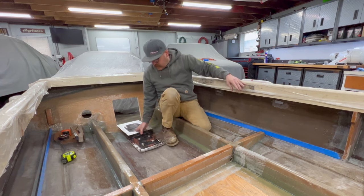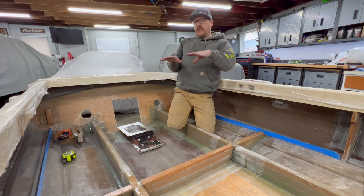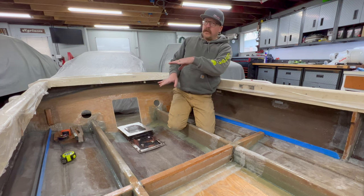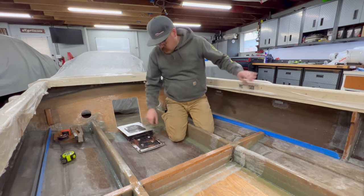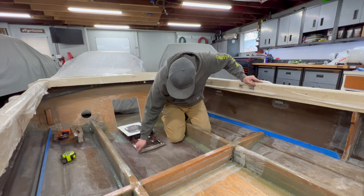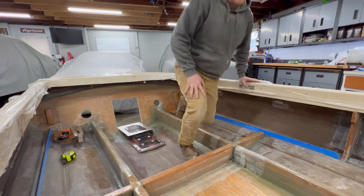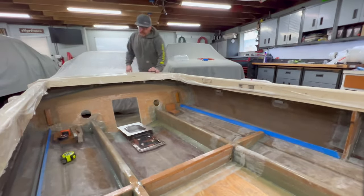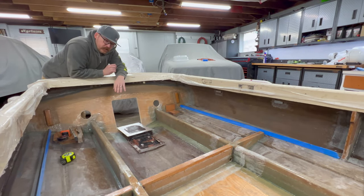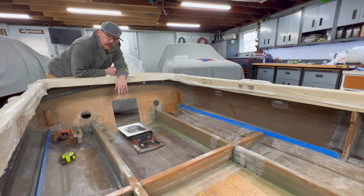I can see that the leading edge of the intake is hanging down below the keel and I need to bring it up and level with that. I'll go ahead and get those front ones adjusted — I have to jump under and go by feel and by looks to make sure it's sitting where it needs to sit. Once I get the front locked in I'll go ahead and bring you guys back and show you what we do for the rear.